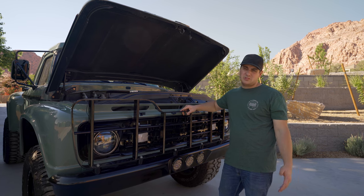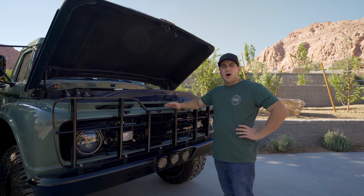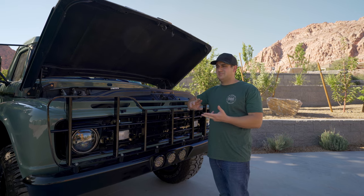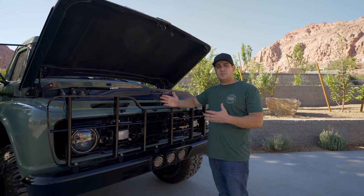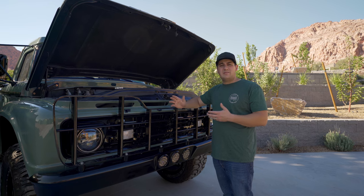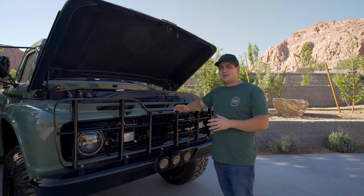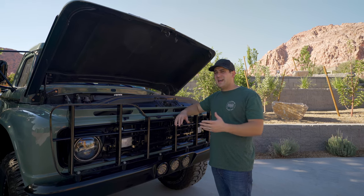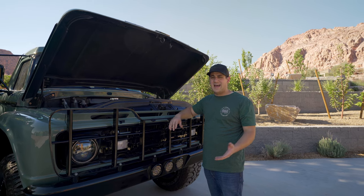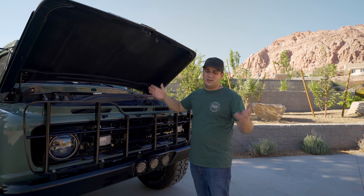This 460 is fueled by a Holley Sniper fuel injection system along with their HyperSpark ignition system and distributor. I love the Holley Sniper for fuel injection on an old school motor - they make them run really great and if you're familiar with tuning you can make these things run like an absolute top. However, I don't think the HyperSpark is that great of a product - it's finicky, doesn't quite operate correctly, and there's a lot of guesswork involved. I'd recommend doing the Holley Sniper for fuel injection and then grabbing an MSD 6AL and MSD distributor instead.